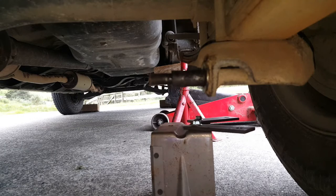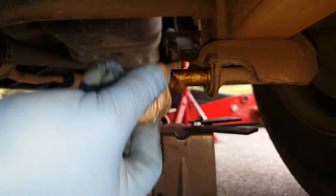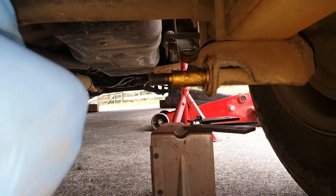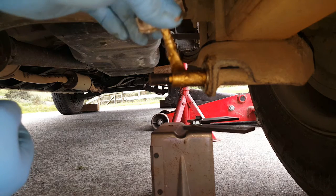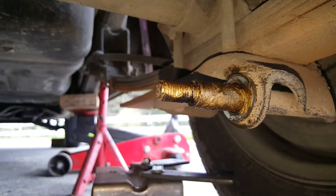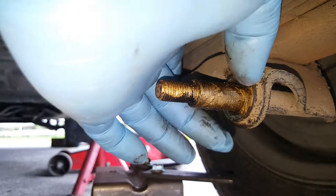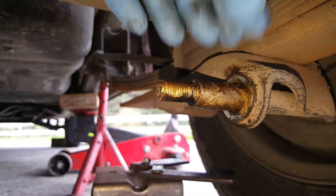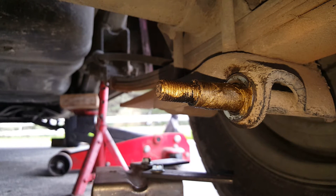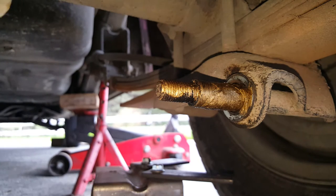See you outside. Okay, so this is the lower mount, the one on the spring base plate, and I'm just going to put a bit of copper paste on there, and that's going to help. Do a little bit on the threads as well. There we go, look. Right, so once you've put the copper paste on both the two mounts, there's no washer on this one, but at the top we're going to be putting the large diameter washer on the inside.